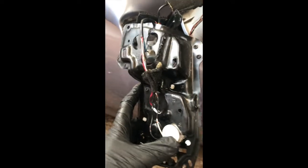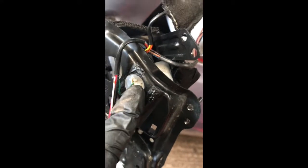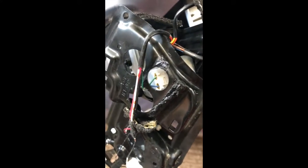When that's removed you can see you've got the metal plate now loose. It's being held in place roughly by the harness under here. This is quite tight. So if you want to get this connector out, you just need to lift the white flap and then prise the white part towards the front of the car.